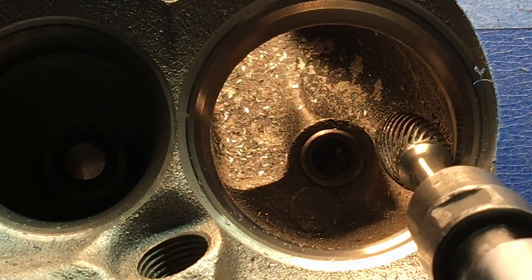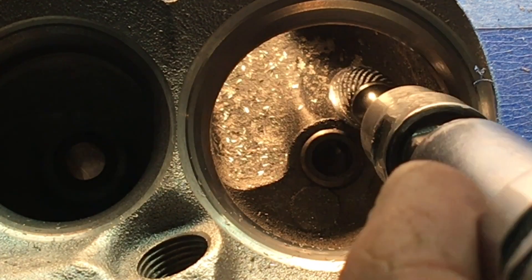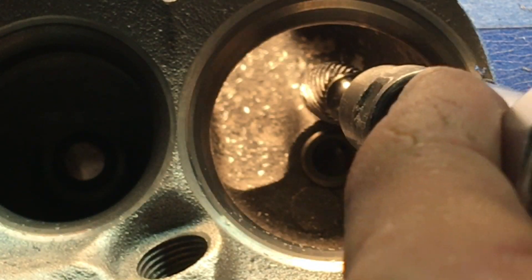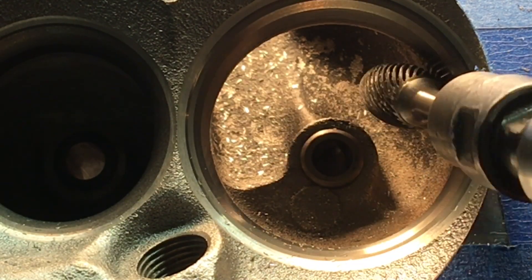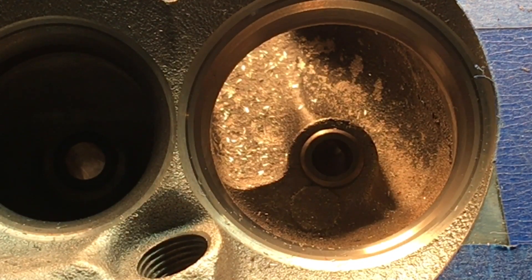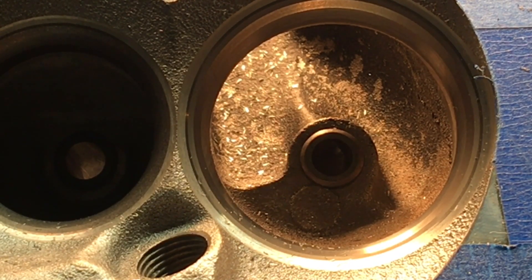What we're going to do is come in here and pull all that off. When you start working this, slowly, just think of flattening that out — just bringing it down to the material that's below it. Because when I move the tripod over, you'll hopefully be able to see how bulbous that aluminum material is at the top of that guide boss right below the guide itself. It literally has a huge bulbous funnel, for lack of a better term.